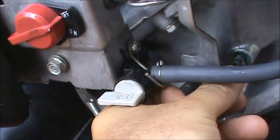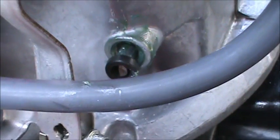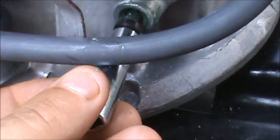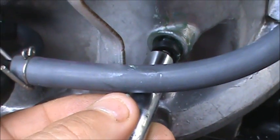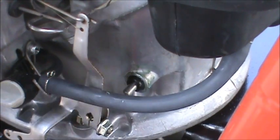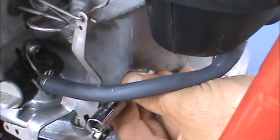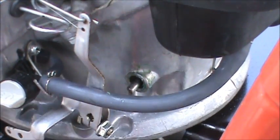We're going to try and get the seal slipped onto the shaft a little bit. I'm going to be using a 9/32 deep socket, and we're going to line it up with the outside of the seal and tap it into place using a hammer. I used my fingers to line it up about where it needs to be. I'm going to take my socket and hammer and just lightly seat the seal. You'll see it's a nice snug fit. There we go — it's seated in there.